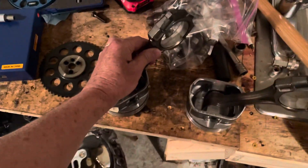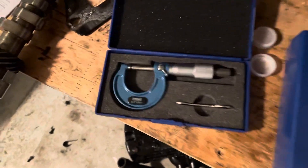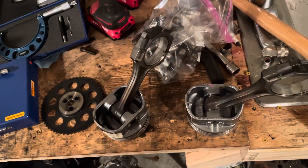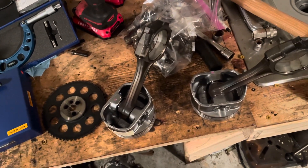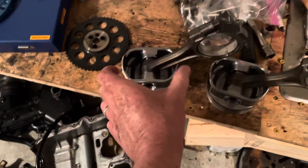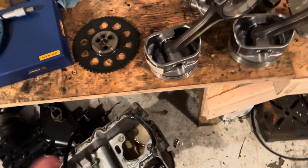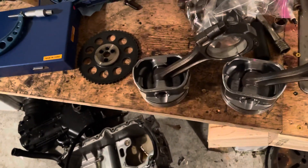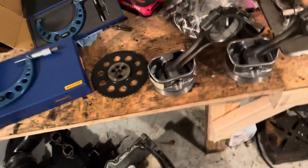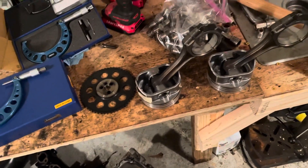I bought an extra micrometer — much less than $175; I paid $40 for one and $60 for the other. I took a zero-to-one-inch micrometer and measured the width of the rim of a penny at the top of Lincoln's head, and it came out to 0.0590 or 0.0591 inches. So you take the two pennies, place them on the piston, measure the total width including the penny rims, subtract the two penny widths, and you get the true reading of the piston width inside those windows — the true aluminum dimension.